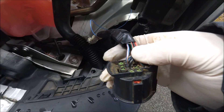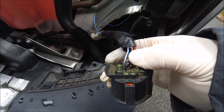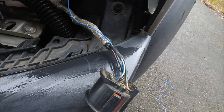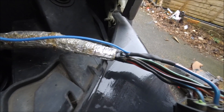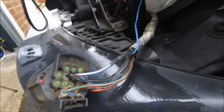That's the one you need to put your Scotchlok connector into to tee in the blue wire, or even better if you can cut it, solder it and do a heat shrink connector to keep the damp out of the loom. Here you can see I've actually soldered this blue wire in and made a heat shrink connection there to keep the moisture out.